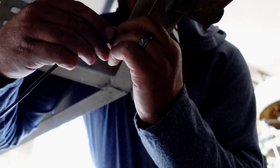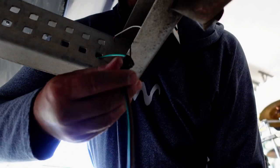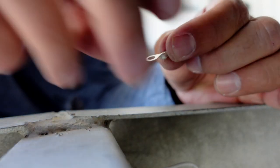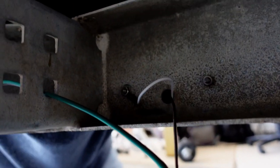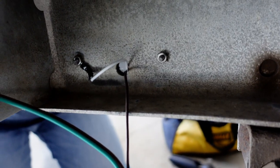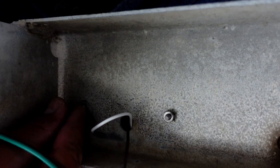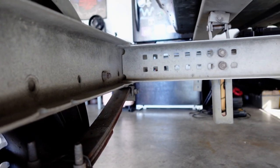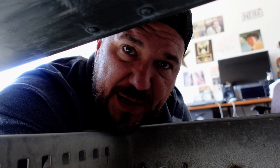That's the thing with these trailer lights — they need to come up with a kit that has everything waterproof. Now you take this white wire and use this little connector that comes in the kit — slide that up on there. As you can see I've got my ground wire on one of the bolts that the light attaches to the trailer with, so it just grounds it out. Then I've got my splitter and I'll run this all the way back to the tail light and we can test it out.